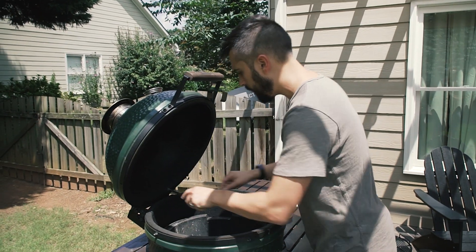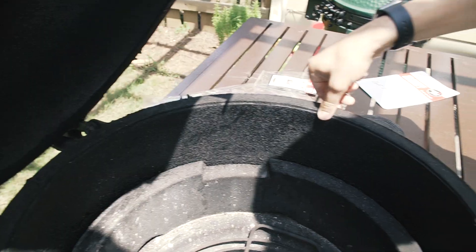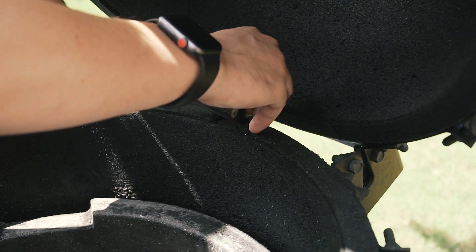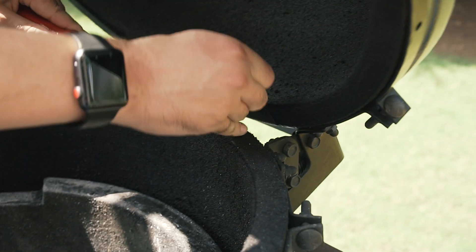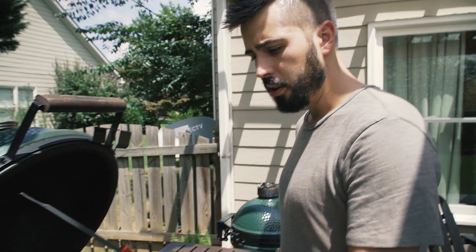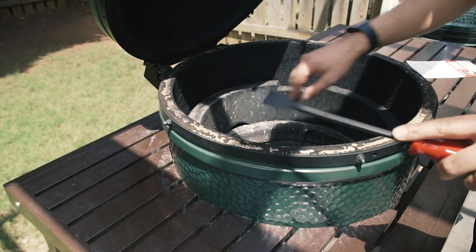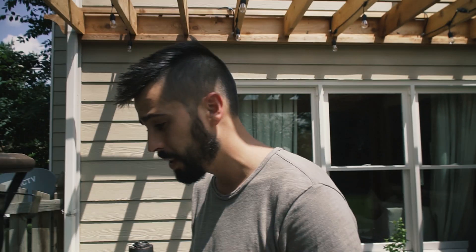What we're going to do is just find where the seam is on the old gasket. This one's hard and I've needed to replace it for a while, so I'm excited about this. I found the seam and I'm just going to get as much of it as I can with this scraper. It's coming off pretty easy. Now I'm just going to follow it around with the scraper and really dig in, because there's excess black stuff and some fuzz around it. We want to get it all the way back down to the ceramic so the new gasket is going to stick really well.